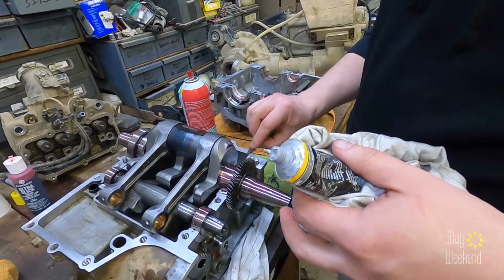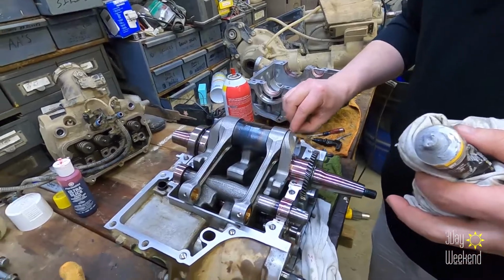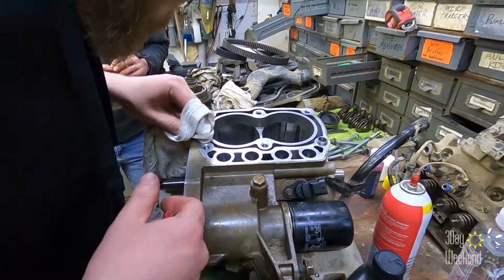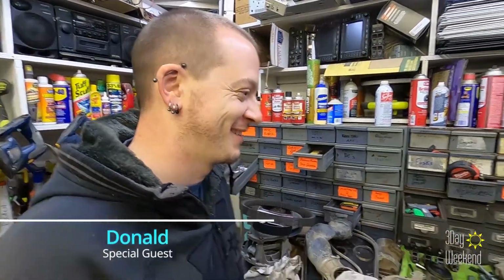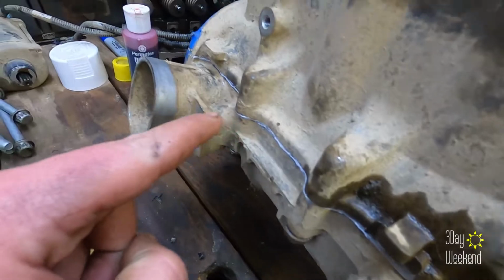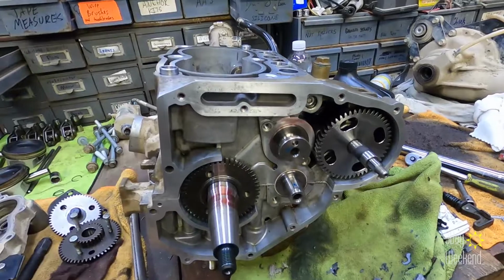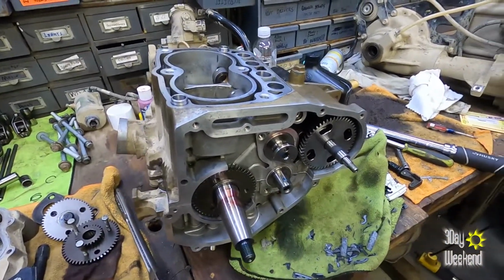Polaris, well, the Yamaha version of Polaris crank seal, Yamabond 4, making it nice and thin. Here's the peanut gallery. Look at that perfect amount that came out. Beautiful. Probably won't leak. It's like 89% that it won't leak.